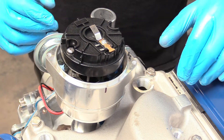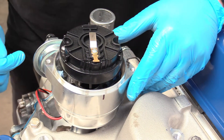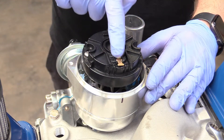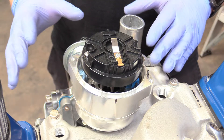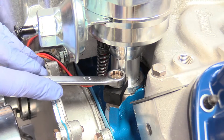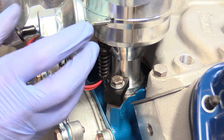I've updated my gold mark to a black one so it's a little easier to see on camera. We can work that down. We can see that we overshot it just a little bit, so we pull it back up, rotate it a little more, and try again. I'll admit it took me a few tries, but just keep at it and you will nail it where the rotor lines up perfectly with the mark for number one. Now we're going to advance the timing a little bit — about 10 degrees or so — to make sure it starts up when we first hit the key, whether on the dyno or inside a car. I've already put down our hold-down piece. Half-inch wrench — just snug that up. You want it snug enough that the distributor can't turn anymore; it doesn't need to be hulk tight. You don't want this to spin on startup — that'd be embarrassing.